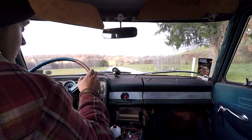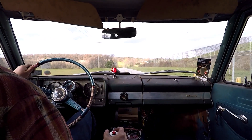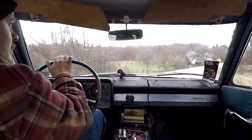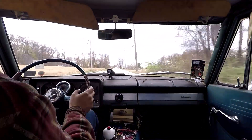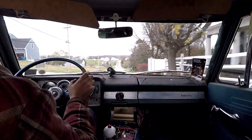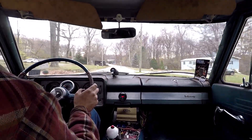So I took it for a drive. I got the thing under boost quite a few times, and we then inspected cylinder number four again. You can see that it has significantly cleaned up — a lot of the oil that was in the cylinder had burned out.